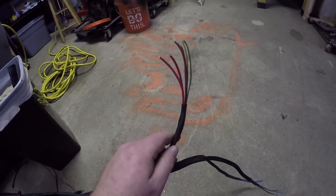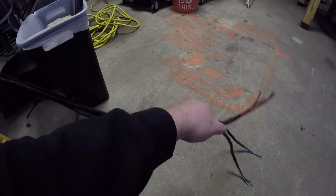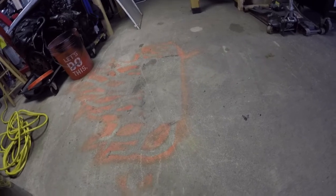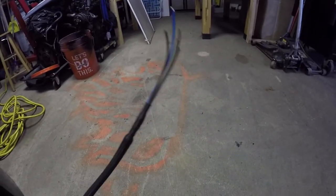We've got three strands coming off this. This one here is going to be the primary switch panel, which is already wired into the dash. This is our power — it'll get a two-pin plug and go to our battery kill switch. And this one is our auxiliary switch panel, which I haven't made yet but it's going to be in the glove box. It'll be for rad things like the stereo, strobe lights, underglow, and all that — stuff I don't need access to while I'm driving. So there's the install.